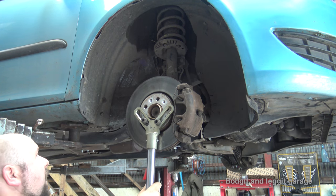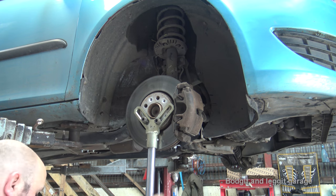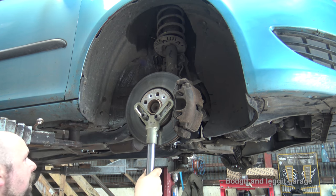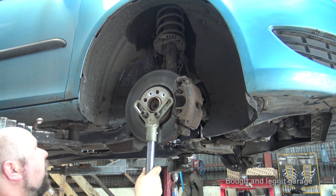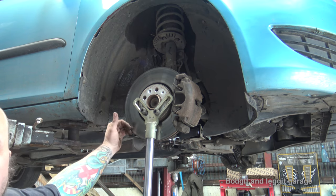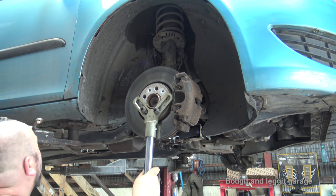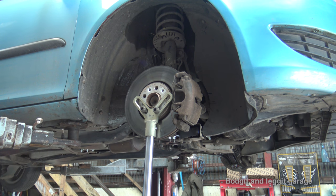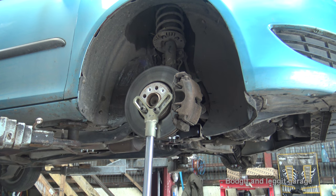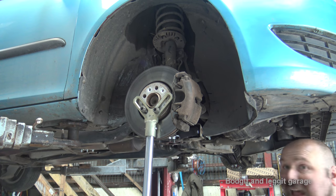All I'm going to do now is very, very slowly — and you have to allow the spring to actually compress, don't just pump it up because you will be lifting it off the lift or off your jack. So very slowly, give the time for the shock to actually compress. Then you can very slowly just raise it up until your wishbone is at the right level. Then we just need to bang them in with the gun. Zip them in with the gun — and that's it.